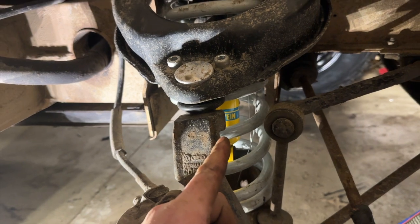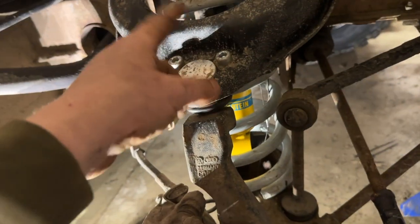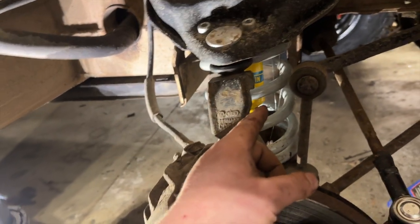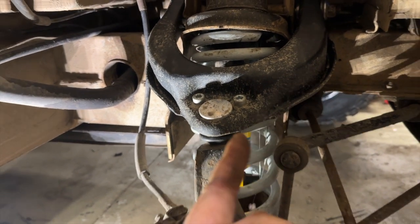We lost some footage, and at some point we switched from the old worn-out shocks to some brand new Bilstein HDs. Once the suspension worked properly we found those shocks really were in bad shape, so we got Bilstein HDs — not the XHDs, the regular HDs — matched with the Go Westy Zero Lift Springs for this lighter Doka. It seems to be perfect. To install: compress the shocks while they're out here with the perch on top using stainless steel zip ties, get the whole thing up in there, then cut the zip tie and feed it out. Works really well.